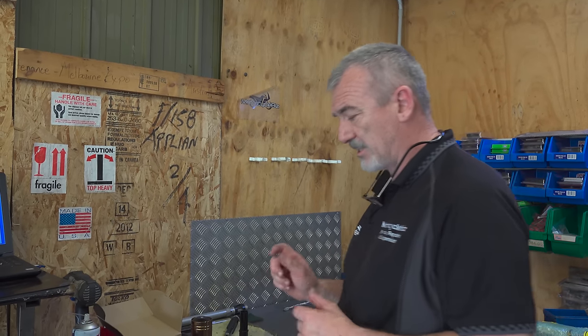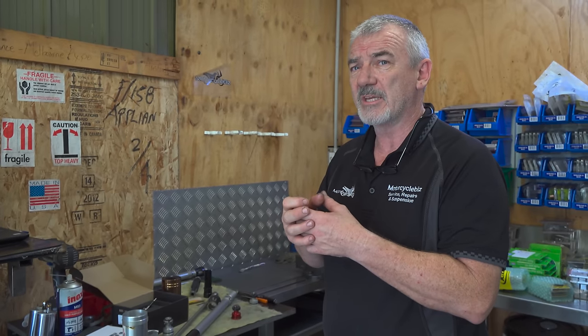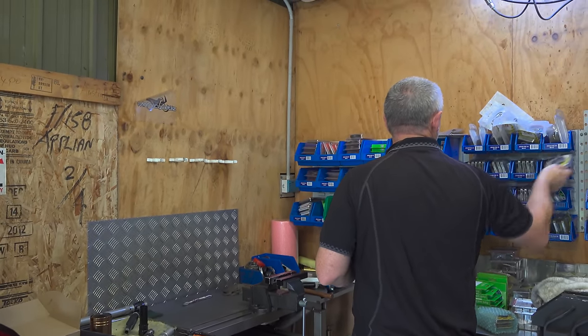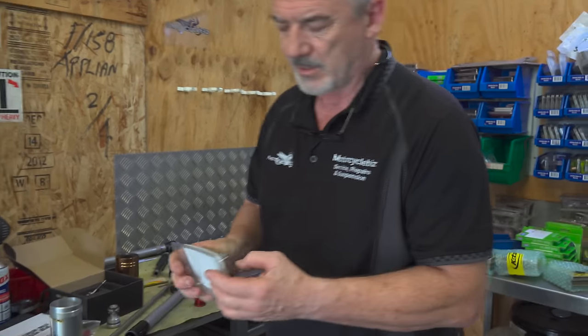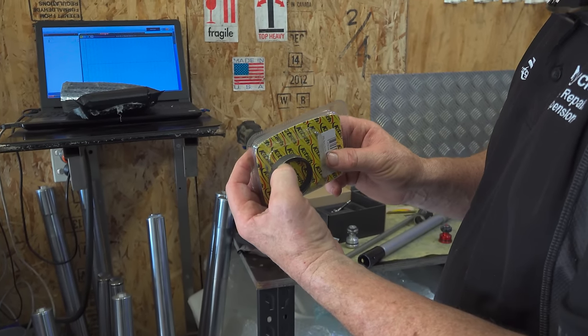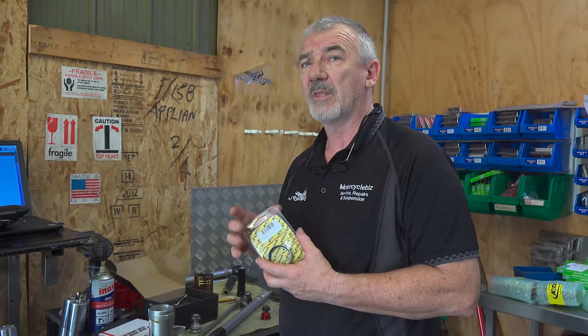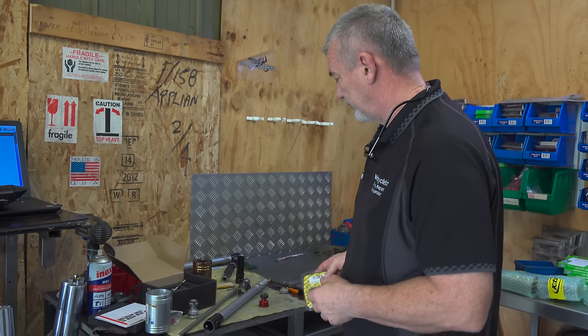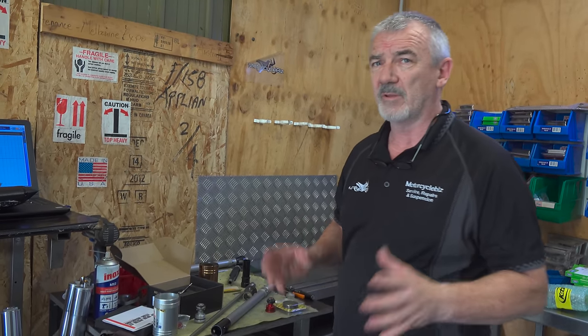We're also going to take the standard piston band off the piston, which is a plastic sort of composite one that's quite sticky and causes a lot of stiction as well, and replace it with a Ktech one, which is the old style. It's a bronze bush with a Teflon coating, and that will get rid of a lot more stiction, and it will make the body last longer in that shock because there'll be less wear and tear on it. We'll also revalve it, and then we'll put the springs in to match the new weights of the bike and you as a combination that we'll calculate shortly.